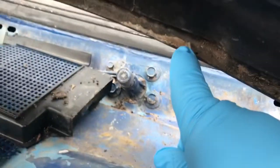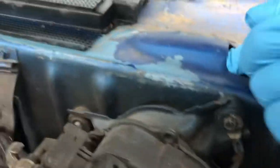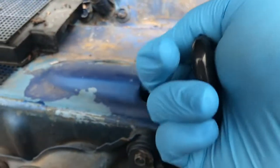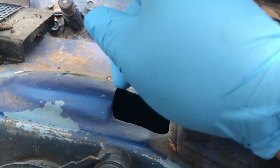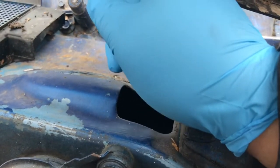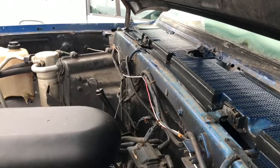I've been working on the hood, trying to get it to fit right. I got it pretty good, but I noticed something right here on this side — because of this indentation from the firewall, the hood doesn't shut all the way. It gets caught up on it and it causes this lip to sit high, and then that lip over there to sit really low.